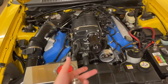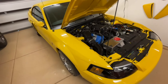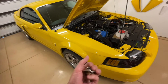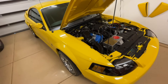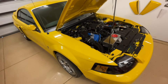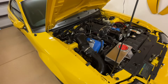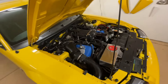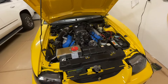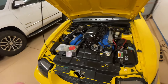Something we always talk about with these supercharged cars is detonation happening. Basically, you don't want the fuel to pre-ignite. If your engine starts to overheat because you've removed the thermostat, the engine is in an overheating condition and it starts to be so hot that fuel can pre-ignite before it's supposed to — that could cause engine damage. We always talk about that under boost, but it could also be happening just at low speed because the car's overheating. That's what happens when cars do overheat: they start to have engine knock because the octane isn't sufficient enough and the fuel pre-ignites.